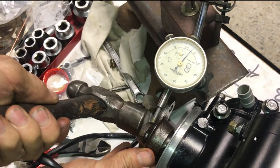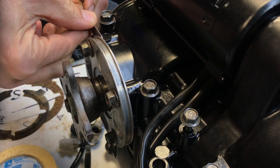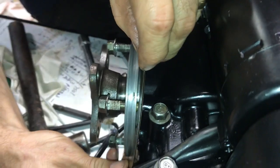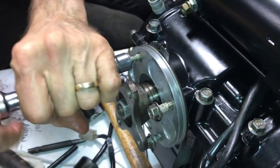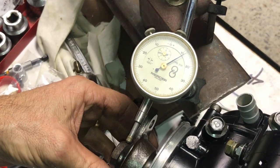One of the last things to do is adjust the backlash in the drive gear — it needs to be four to eight thou. Keep knocking it in with a hammer, measure the clearance to know what size shims to put in, then simply put the shims in, tension it up, and check the clearance. I end up with a clearance of about five thou, which is right between four and eight thou, so this is looking really good.